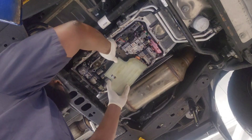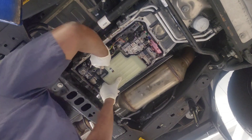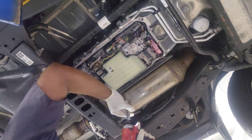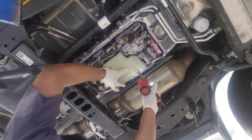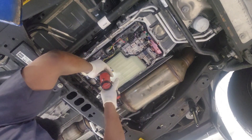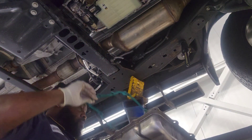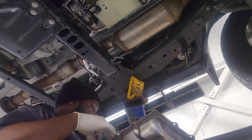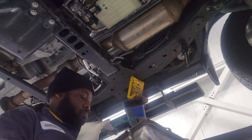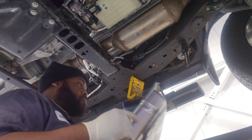These valve bodies do have special bolts that hold the valve body together internally. The bolts I was referring to are the ones that hold the valve body to the transmission. The internal bolts require a special tool to remove — I don't have it yet. I thought I'd need it but I didn't. It's some kind of Torx bit. I also noticed it on the valve body cover inside the transmission. Most GM vehicles have that special bolt — don't remove it unless the service information tells you to.